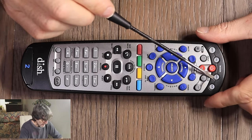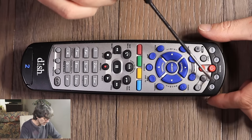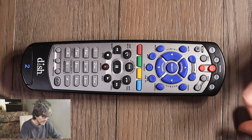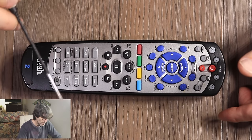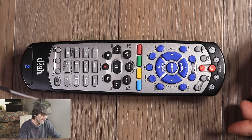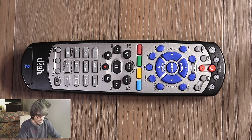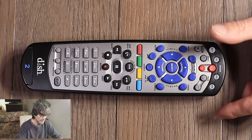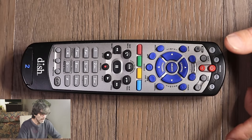To program a DVD, you're going to do the exact same thing I just did, except you're going to be pushing the DVD device button instead. For Auxiliary — used for an additional TV, VCR tuner, or amplifier — you'll do the same thing by pressing it until the other lights come on. But when you look up the code, before the manufacturer code, you're going to have to input a 0 for a TV, a 1 for a VCR, or a 2 for an amplifier. For example, for a Bose amplifier, you'd use the auxiliary button and put in 2753 pound with a 2 in front because it's an amplifier. I'm not going to demonstrate this because I have another use for the auxiliary button that I'll show you a little later.